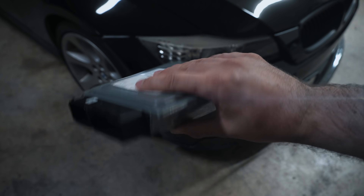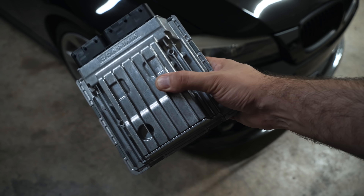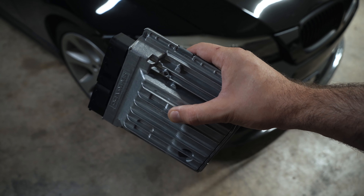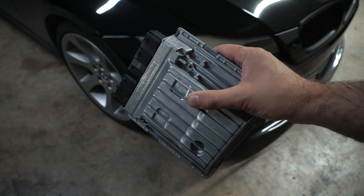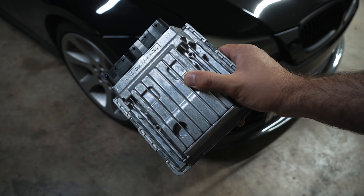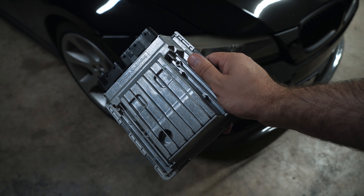Just to give you guys an idea — you'll probably find this useful. As a little sneak peek, as soon as I put in my new ECU I was having a stumble issue. I ruled out that it wasn't coils or tune or anything like that. Turns out that the moment I put that new ECU in, drove around the block a couple times, shut off the car and drove it again, it caught that my secondary O2 sensor was bad — and my old ECU was not able to do that, only the MSD81. The secondary oxygen sensors actually influence the primaries; they help calibrate. So all along my issue has been my O2 sensors. There are real differences with the MSD81 ECU.